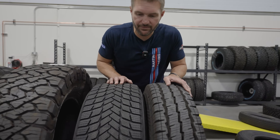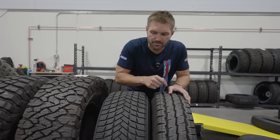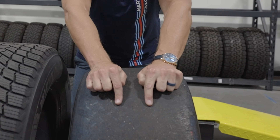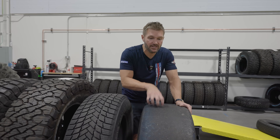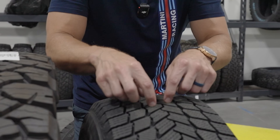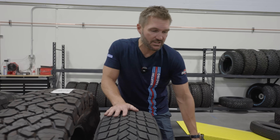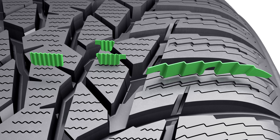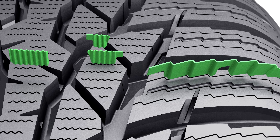Compare the channels of the rain tire to the standard tire — the lugs on a standard tire aren't even split up, yet the rain tire has constant literal channels. If you have a slick and the surface is wet, water under the middle of the tire might get squished to the sides but it's still under the tire, meaning you have literally no contact with the road. Driving a slick on wet pavement is almost worse than driving on ice. The rain tire uses all these channels to let water get squished into a channel so your rubber can drop through and contact the road, and it doesn't hydroplane nearly as much as a slick would. These little wiggly lines are called sipes — micro channels that allow water to seep in and provide additional grip.